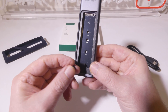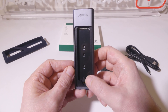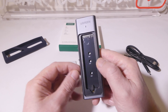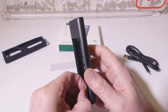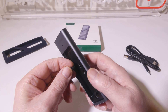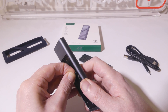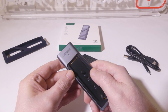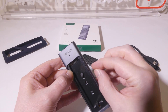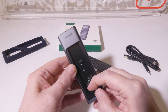They give you an extra tool-less hold-down for your drive, and you can go from 2230 all the way up to 2280 — so 2230, 2242, 2260, and 2280 are all supported. I'm going to install the smallest drive, which is a 2230, just to show it can be done. Your normal size is usually a 2280, but I have a 2230 that I had in my ROG Ally, and I'm going to put it in this external enclosure for extra storage space.